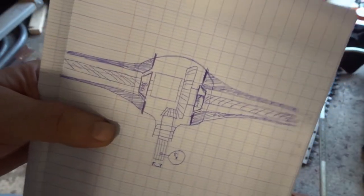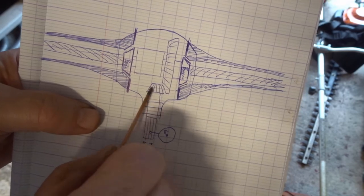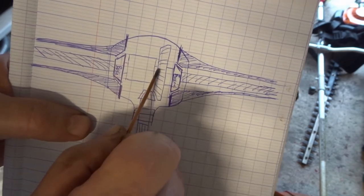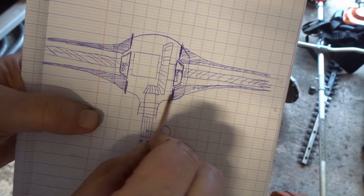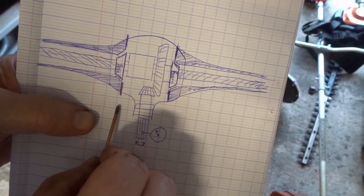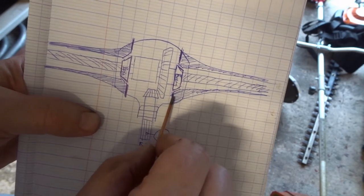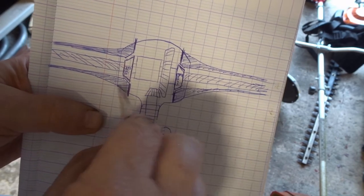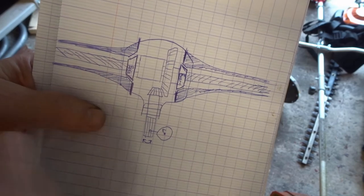This is one of those moments where you need to just stop, think, have a cup of tea. These are meshing too well - there's no free play here at all. So all I need to do is move my crown wheel that way relative to the pinion. If I make that gasket thicker, this bearing seat moves that way. I need to make this bearing seat move that way too - so I need to make this one thinner and this one thicker. At the moment that's the thin one and that's the thick one, so if anything I need to swap them round like I had originally.